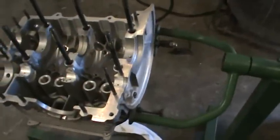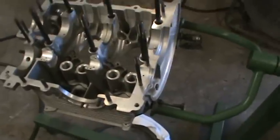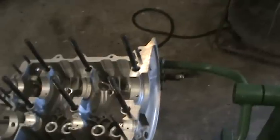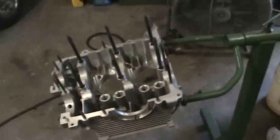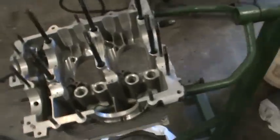So that's where we're at on the 2 liter. Haven't dug any heads up. We're going to go ahead and get the short block with the rods hanging out of it built, and then we'll build a set of heads. I got a set of heads under there somewhere, some big valve heads that we have to do a valve job on, and some guides and a couple seats. That'll be cool. And that's where we're at.